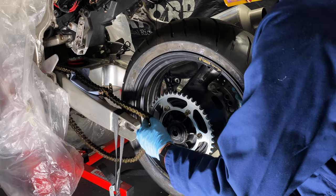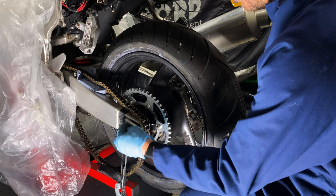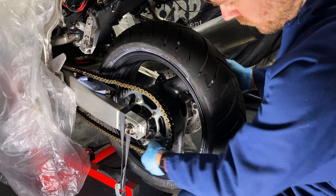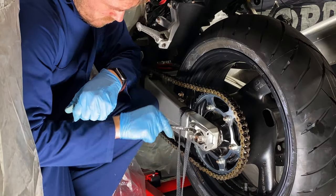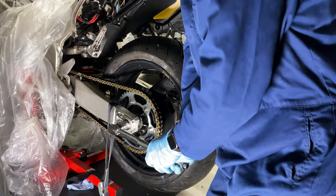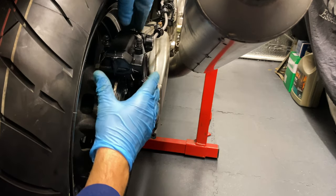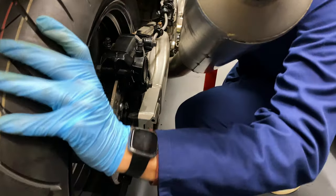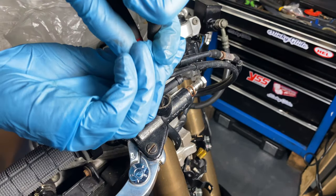Once in, I did the same for the rear wheel. Then I refitted the rear brake for what felt like the tenth time on this project. I had to make a slight adjustment to the angle of the reservoir hose on the master cylinder — this was just a case of removing the boot, then undoing the circlip, which allowed me to twist it round.